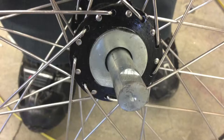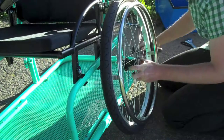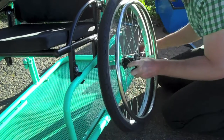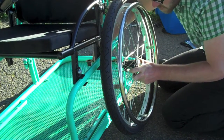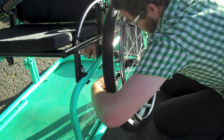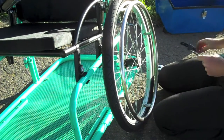The rear wheel clamp has both a bolt for the groove on the axle spindle and also a clamp to grab the axle. It's important to make sure that the groove on the axle spindle is aligned at the very top with the bolt that is tightened as shown. You can tighten it, jiggle it to make sure it engaged, and then tighten the lock nut on that M8 bolt. Next, tighten the clamp, which is an M12 bolt, using 19 millimeter wrenches. In the process check to make sure that you have that slot engaged.